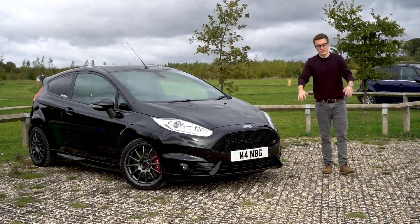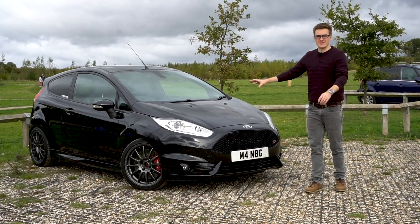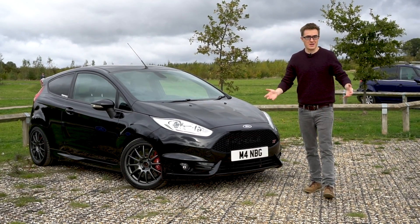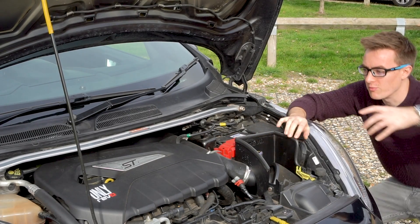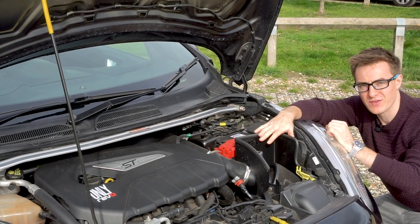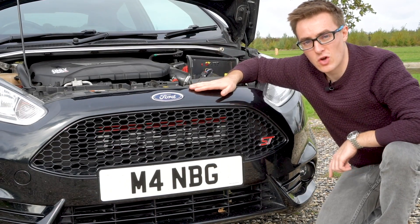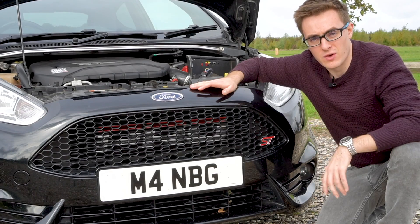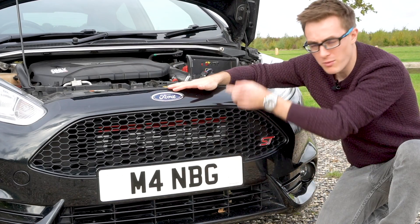Now that we've answered the burning question and we know it's really fast, what's behind all that power? Well, you can't just strap a massive turbo onto this car and off you go. There are a number of essential modifications you need to make in order to make it work. This particular car has Revo's own open cone induction kit with piping that runs all the way around the top of the engine bay, and that sorts the air intake for the turbo. Down here you may just about be able to see the Pro Alloy logo. This particular car has their latest competition cooler, which also integrates the crash bar. That represents a significant weight saving and also allows them to put a massive intercooler that has a 62mm core throughout, all the way up the front of the car.